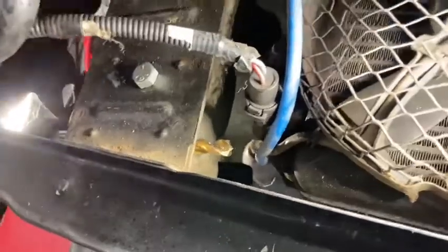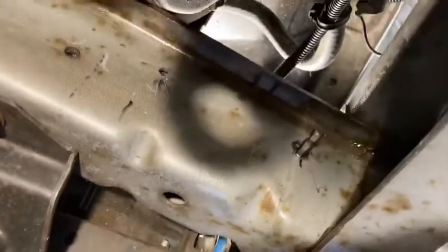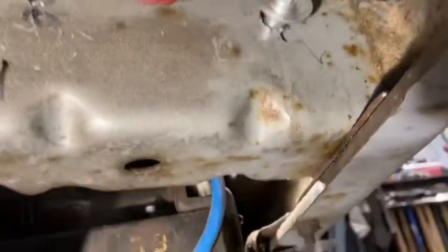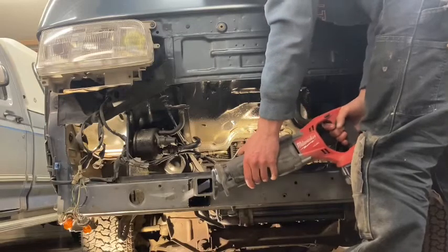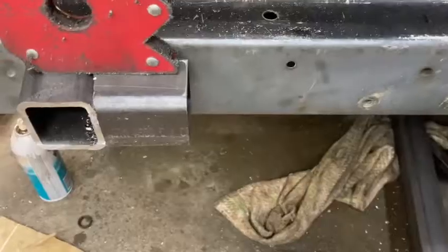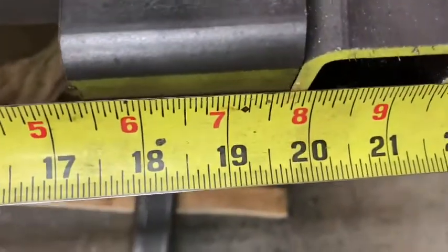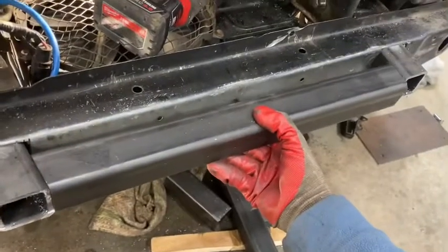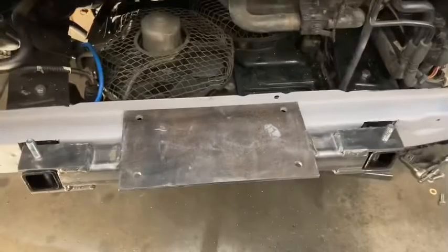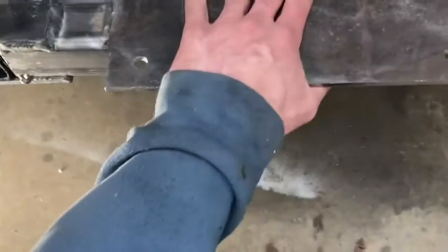On the tighter side I had to be a little more creative — I ended up using a ratchet and a quarter-inch socket onto a drill bit that would fit into that quarter-inch socket and managed to work my way through. The holes are nice and clean, the bolts fit perfectly. Then I marked and cut that square tubing square to the front of the van so the tube running left to right would be square. I measured and cut the piece with the corresponding angle to fit in there, leaving a bit of a gap for welding. Rather than weld the whole thing together, I opted for bigger 5/8 bolts through each side and made a little clevis using quarter-inch plate — a fail-safe in case I ever have to take it out.